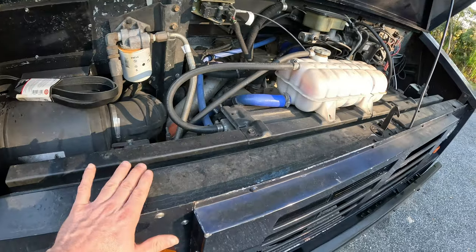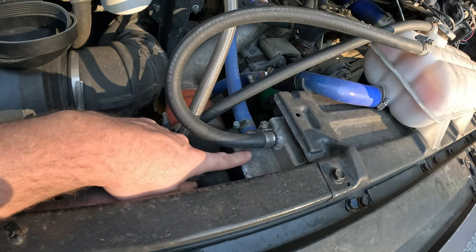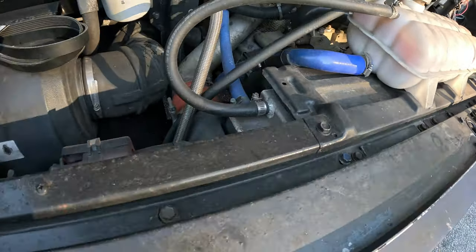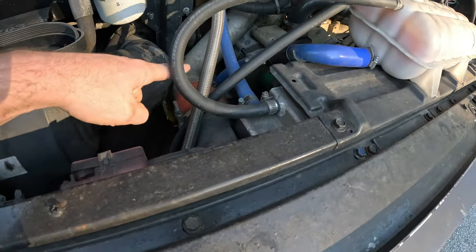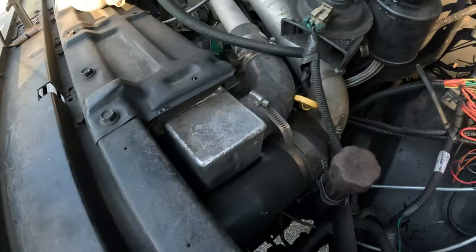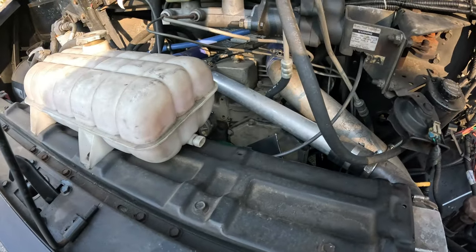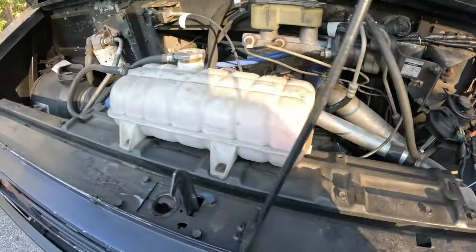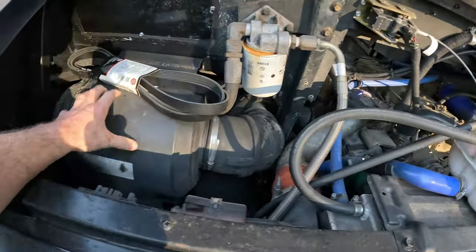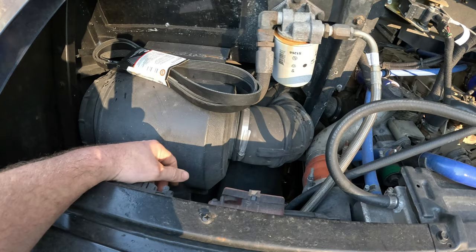Underneath the hood, I used a radiator that came out of an 80s Chevy pickup truck — it just fit perfect, a dual-core aluminum radiator. The intercooler came out of a '96 Dodge Ram 3500 and it fit perfectly, wrapping right around that radiator. A lot of this was built with stuff I had laying around — this intercooler piping I just trimmed to fit, it happened to have the right bends I needed. Same for this air filter, I pulled it off a commercial box truck and it meets the needs for air filtration.